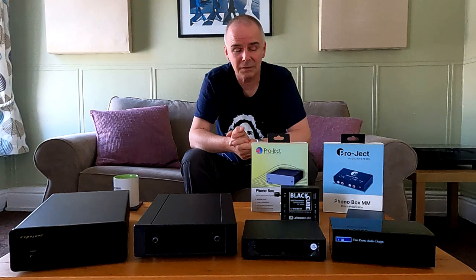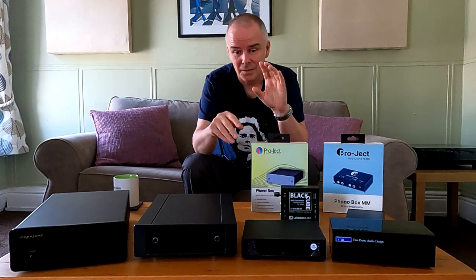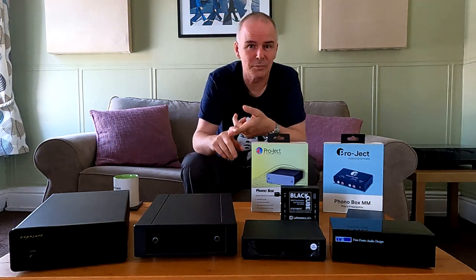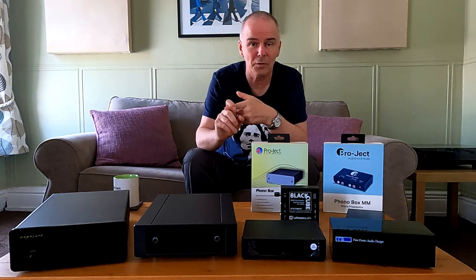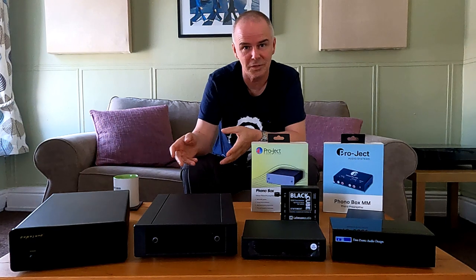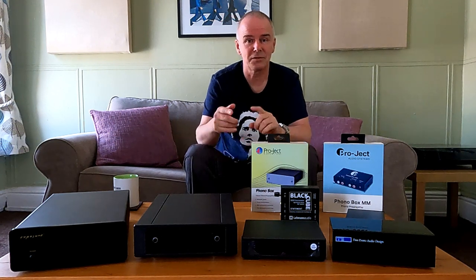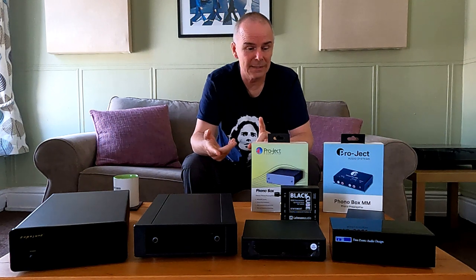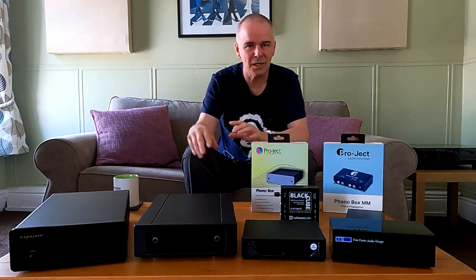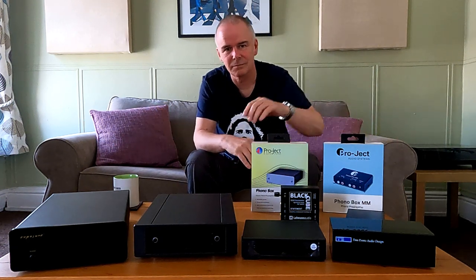So, lots of confusion — hopefully this has cleared things up a little bit. I will move on to doing reviews of all these different things, because there are definite differences between phono stages — different matchings, different capabilities. We'll come to the difference between moving magnet and moving coil: moving coil is an even lower output version of moving magnet, so you need even more amplification and hence more potential for noise, but if you get it right, it's brilliant. We'll look at that in a future video. If you're on the edge of it and not going to start upgrading through to the madder end of it, then perhaps stay at this sort of level — it's fine, it will work.